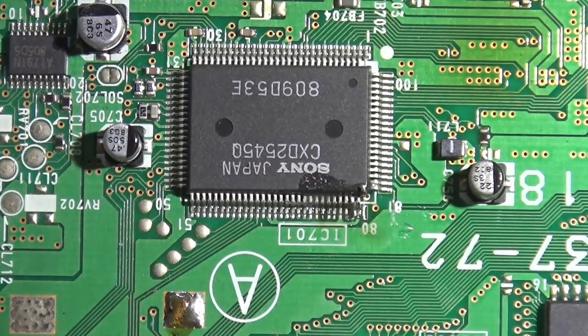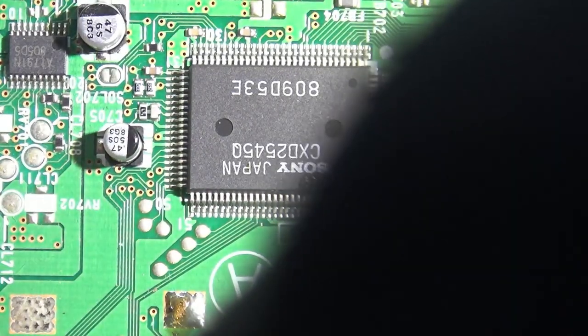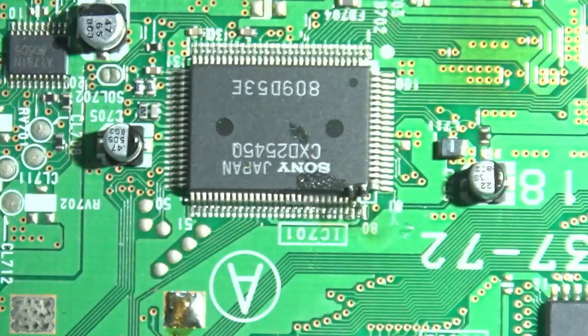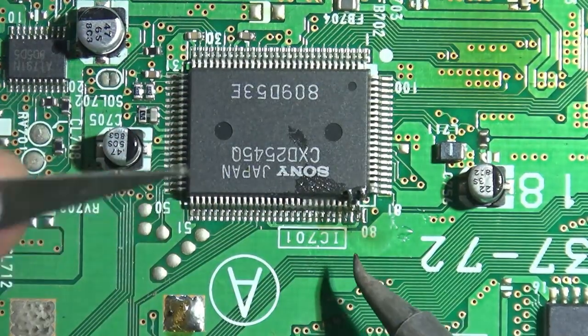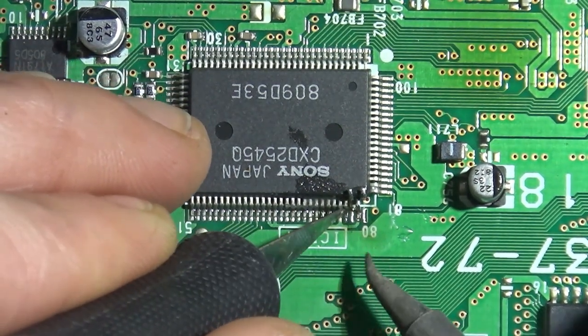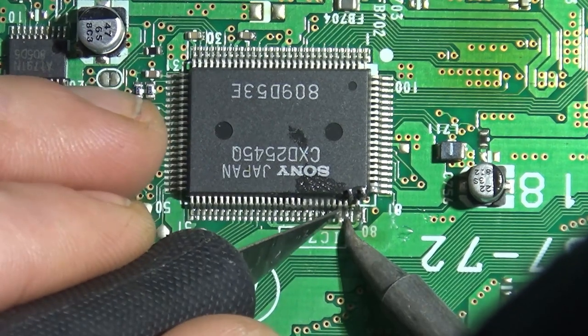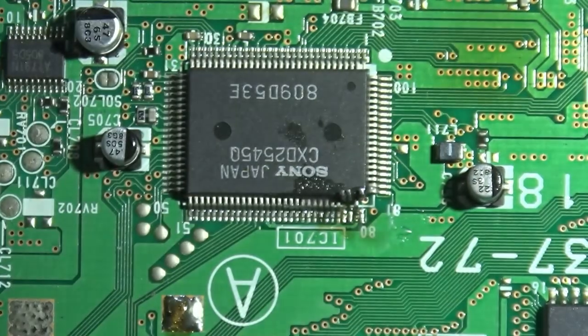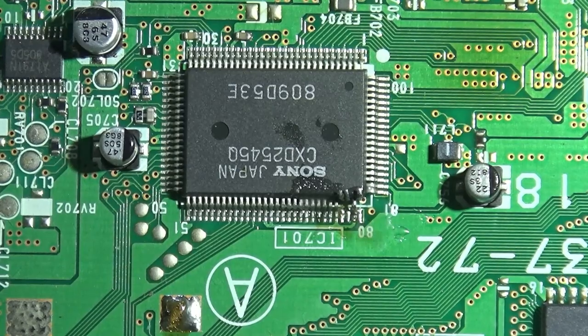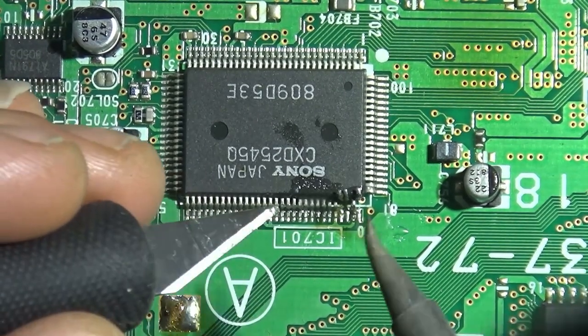And just in case you want to restore this one day, you know, a new mod comes out, you just reattach the pins. I've already tested with the legs back just for the lulls, like bending the legs and then reattaching them all for this footage specifically. And it doesn't look the prettiest, but it's pretty simple to do and works totally fine. You will likely, when you pull those legs up, a lot of times they will bend into the next leg. Sometimes you get solder to it, and it's a little bit messy heating it up and straightening everything out, but it's perfectly doable.